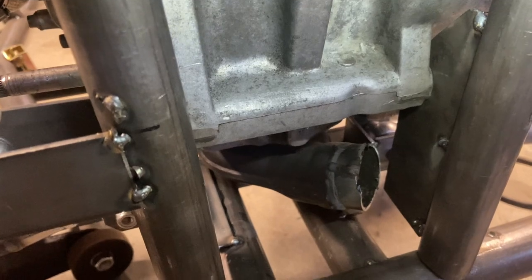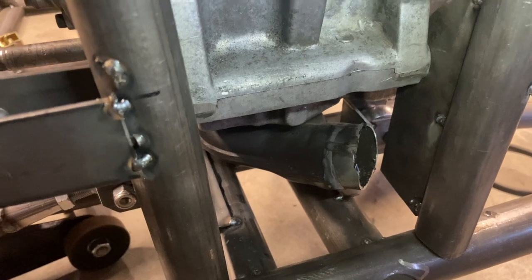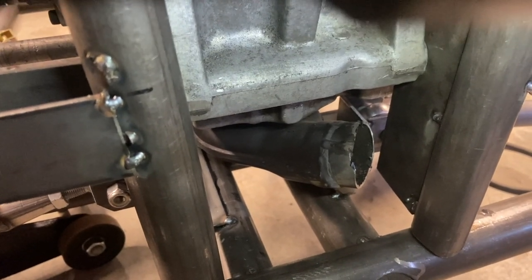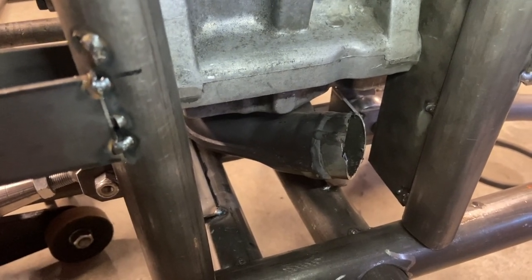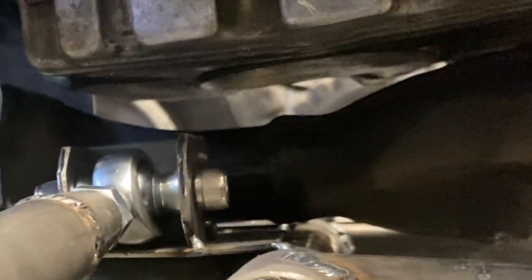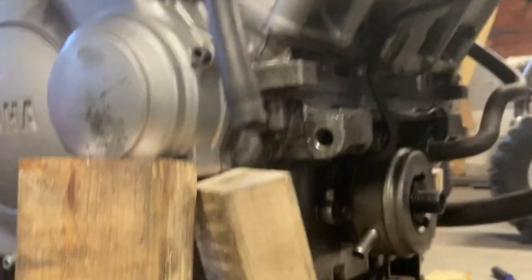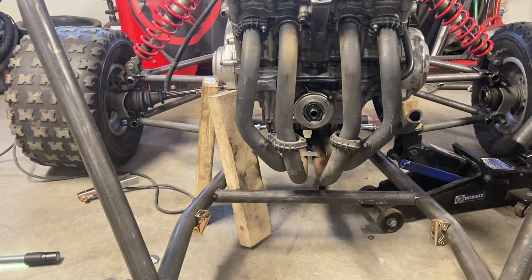You can see we do have a small gap underneath and the stock clearance above. I pre-cut the rear exhaust because I know it's not going to come out from the side — it's going to come straight back. I cut the attachment tab off and cut it after the turn because we're going to make that straight anyway. We're just checking for clearance. The gap is about an eighth to a quarter inch, which should be fine since this engine is going to be hard mounted.